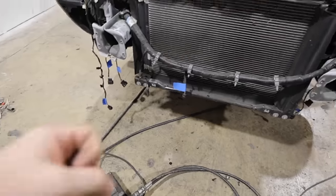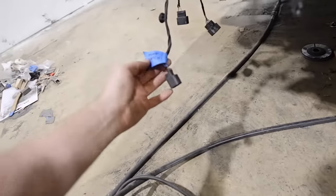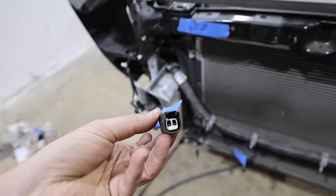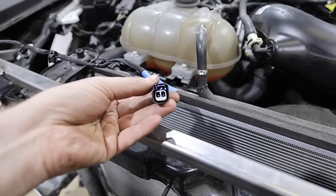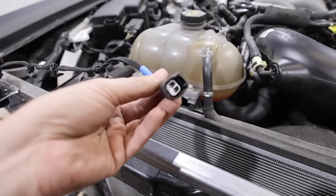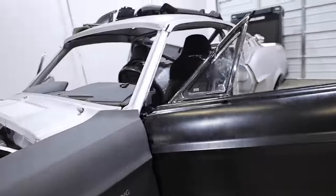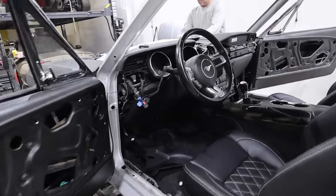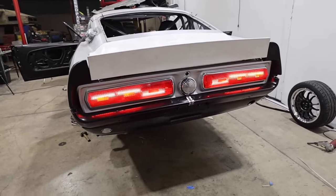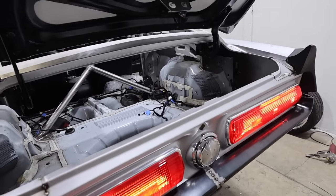Oscar, jump on that and I'll show you guys how to hot wire the hood. When we detach everything from the car, we label every wire — one of these is going to say hood pop sensor, hood latch. If a hood latch is two wires, it normally means if you just bridge these two wires together, it's going to say the hood is closed. Normally. Try at your own risk, but I'm going to jam a piece of wire in between the two female parts of the pin, and I'm betting it's going to say the hood is closed. We got our loop — that's obviously temporary, but as a temp loop, go ahead and reapply power. It no longer thinks the trunk is ajar. Double tap. Boom — trunk's open. Cool. Attaching the wires definitely helps.